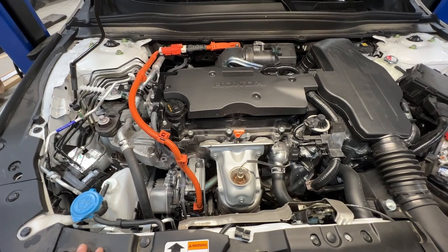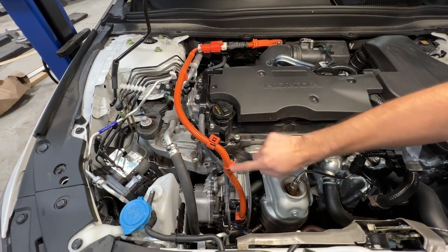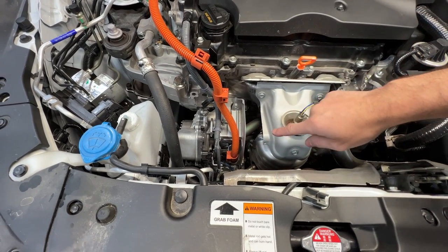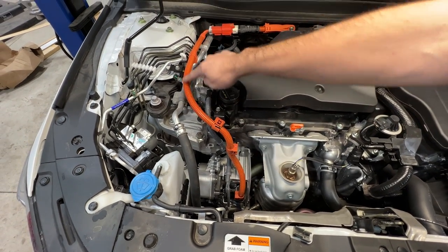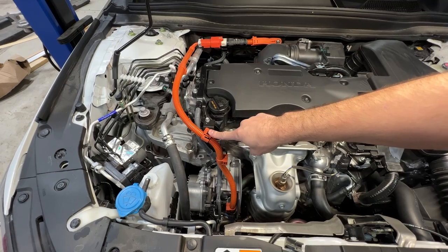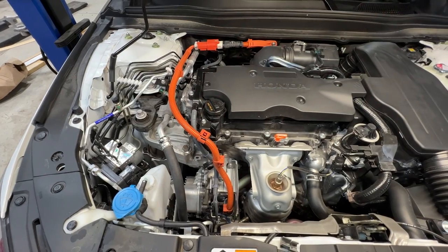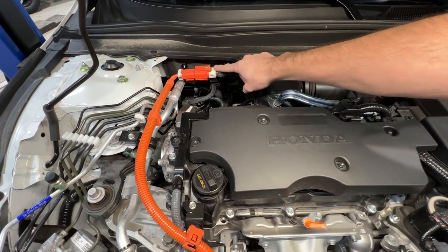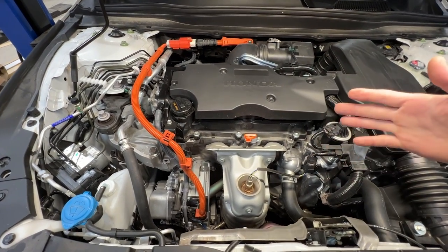So let's take a look at what we have to check under the hood of this hybrid. The first thing you obviously see is this orange cable right here. This orange cable is actually running down to the AC compressor. You can see here that I can touch it and I'm not getting electrocuted. This is orange conduit with the orange high voltage cable inside. So anytime you see orange, it is going to be your high voltage cable — it means don't touch it, don't cut it. You can also see back here the connector has a unique locking tab style so that you don't accidentally disconnect that.